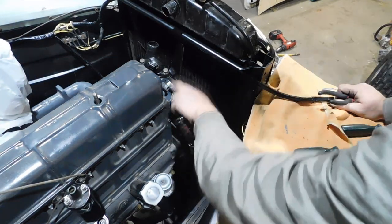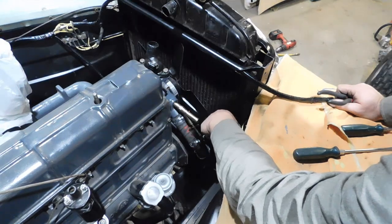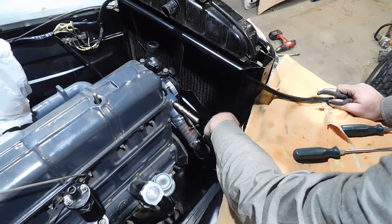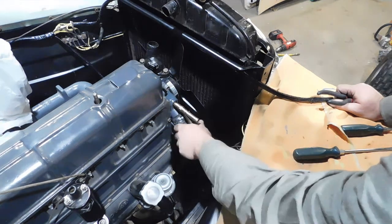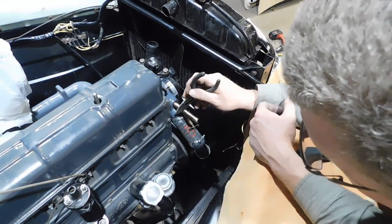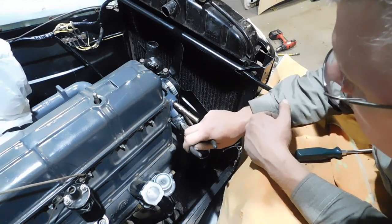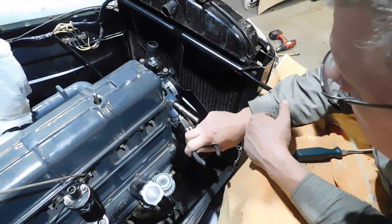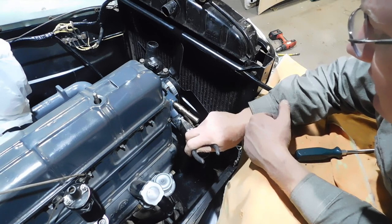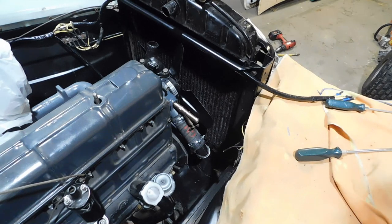And then also, this is a brand new Airtex pump. I'm not too crazy about the brand, but it's what I could find that was readily available and not just incredibly expensive. So I think it'll work, but the casting was definitely larger than the hose, the old style casting. And so I had to get a new machine screw for this clamp that was longer. I just couldn't get the play in the clamp that I needed.